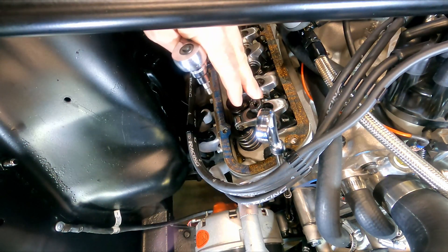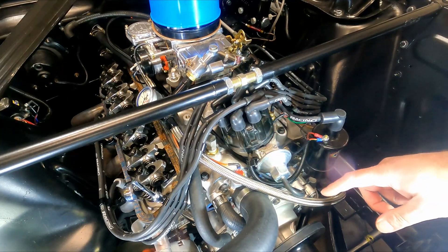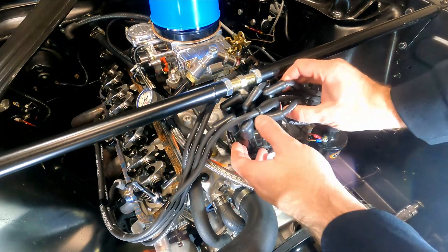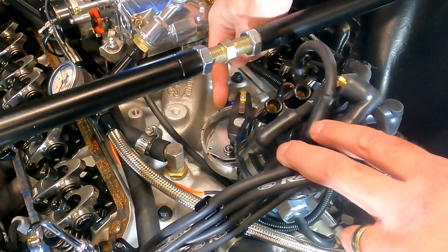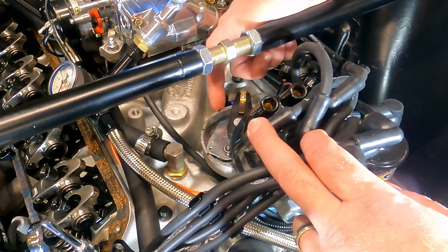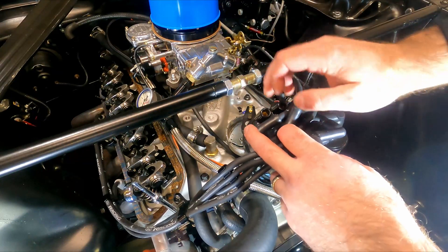You do the same thing for all the remaining seven cylinders in the same exact path. But how do we get to the next cylinder in the firing order? There are a couple of ways. If you can get a wrench onto the crankshaft and spin it 90 degrees, it will put you in line with the next cylinder in the firing order. Or you can do what I've done — if you take the distributor cap off, I marked sharpie marks on it where each one of the spark plugs are, so if I just rotate the crankshaft until it's pointing at the next mark, I'll know I'm at top dead center of the compression stroke for each cylinder.